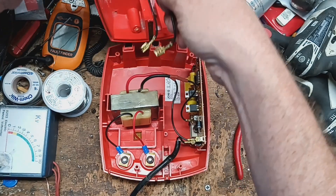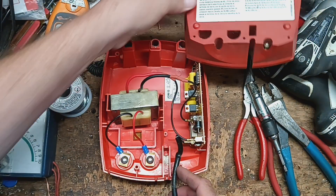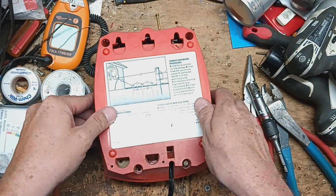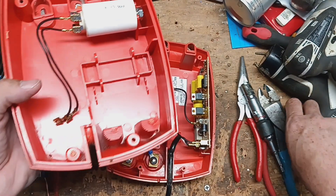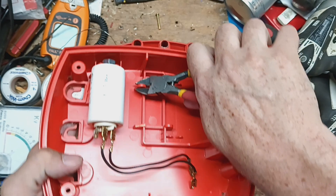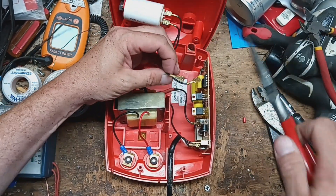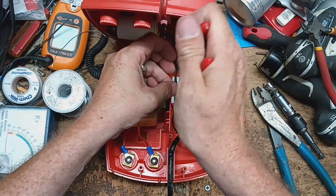Now we'll take the capacitor and close the lid real quick. Sometimes this capacitor is a little higher than the factory one, so the back case will actually hit the transformer — and yep, it hits a little bit. So before we plug the capacitor back in, I'm going to take a pair of snips to these four little plastic pegs right here. They were what went around the old transformer plates to help hold it in place, but now we just give them a little haircut. So now when we put it down in there it should close, and then we'll plug it in and test our output.